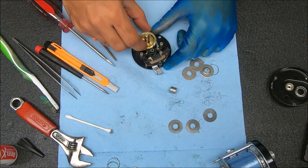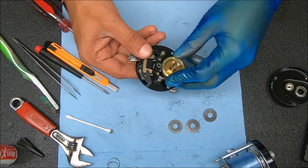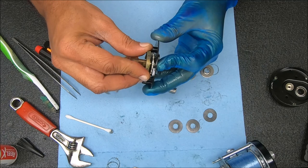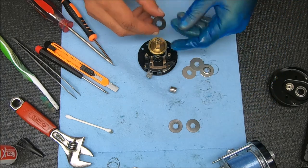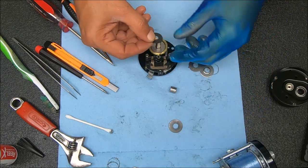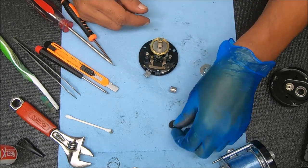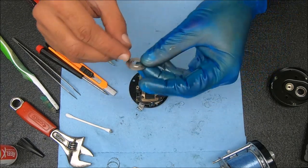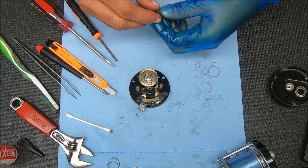Now we can stick this gear on. Make sure you kind of play with this to get that gear down without damaging the pinion gear. First drag washer goes in, then your keyed metal washer. Second drag washer, then your fiber metal washer that sits in those two little holes. Final piece - remember this notched end or raised end will be facing up towards the handle.